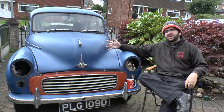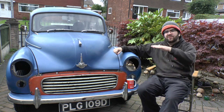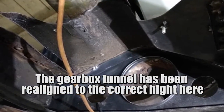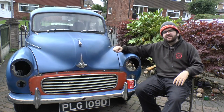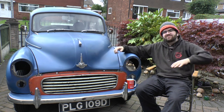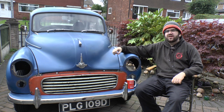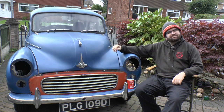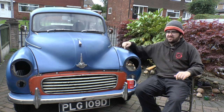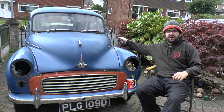The cross member was hollow because the original had rotted away and been plated either side and underneath. The engine: I've never been able to use the starting handle — I thought this was crash damage because the engine sat slightly higher at the front. What actually happened was the floor had been so badly repaired that it sat an inch lower than it should, fouling the prop shaft. So somebody put in a different gearbox mounting cross piece that made the gearbox sit lower, tilting the whole thing. The gearbox mount stays were sheared off.